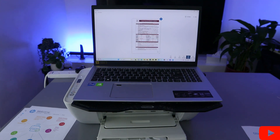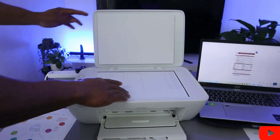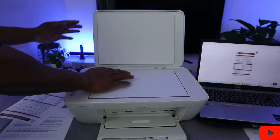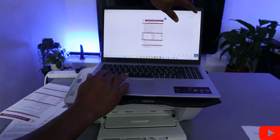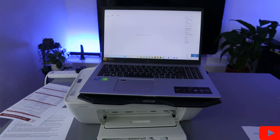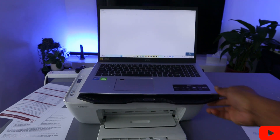This is the document we scanned. If you want to scan another one, remove this document and place the second one you want to scan on top of the glass scanner face down and close it. Select Add — you will see the Add option on top. When you select Add, it will prompt you to do the settings again. Select Scan, select the entire area, and select Scan. This second page is now scanning.